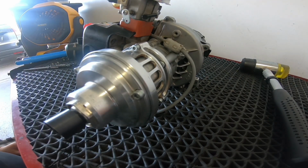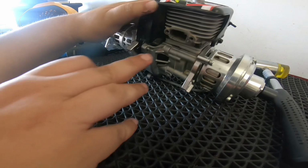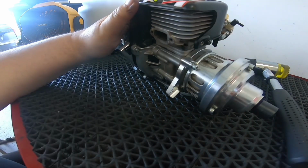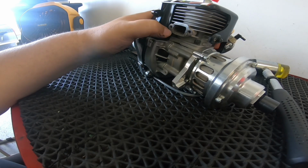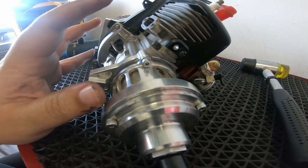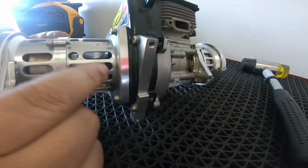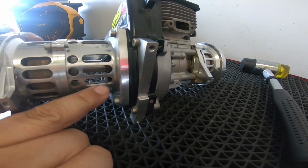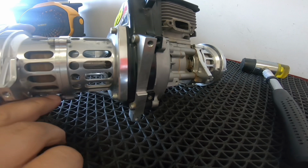Alright. I'll put the manifold on. I probably wanna clean up that surface. Looks like it's used a bit of gasket. There was that Bond gasket, liquid gasket. So that looks like that needs a clean up because that is rough as guts. So I'll do that, and I think that's enough. That's it. Because you have a look at this one. So basically, it's the same. The only difference is this housing there, which has got the starter on it. So that's attached to what was the flywheel, but now that's attached directly to the crank on the starter.